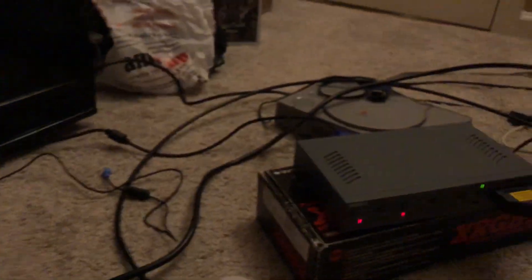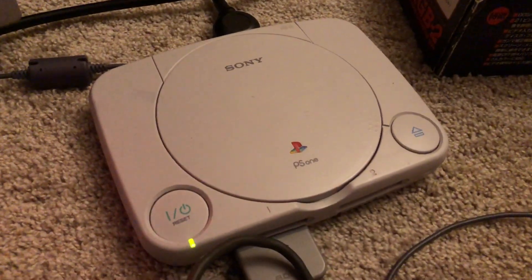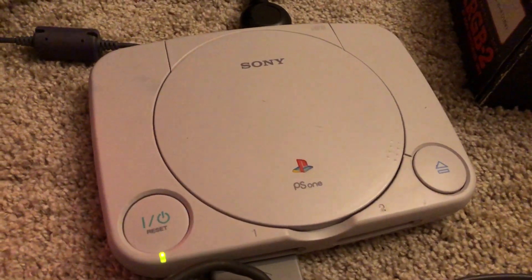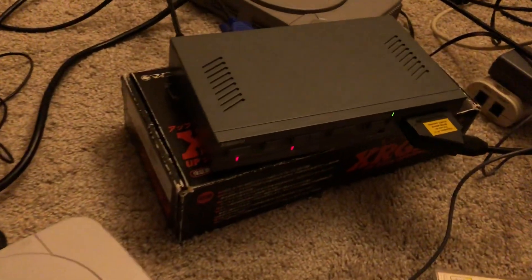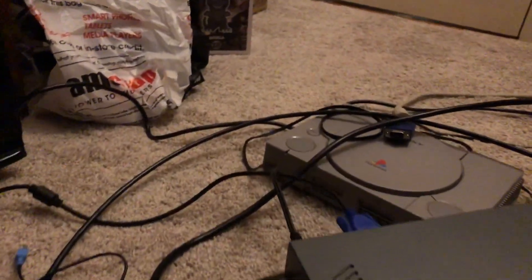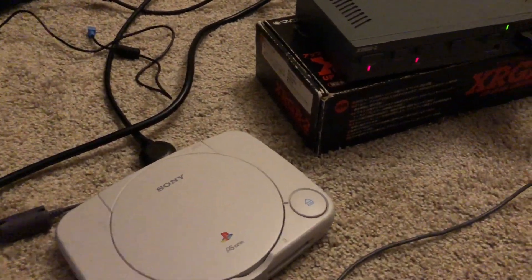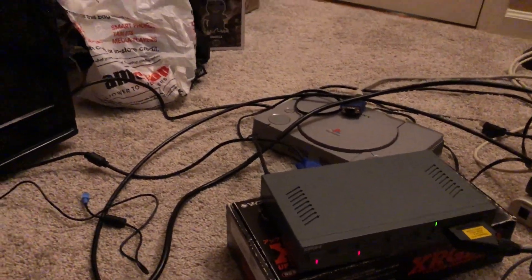How's it going folks? Today I have another monitor to show you, once again running in conjunction with an XRGB2. I have a modded, region-free PS1 console hooked up to the XRGB2 via JP21 pin RGB — that's what the inputs on these devices are. The output is VGA to this monitor, so basically we're taking the low-res 320×240p signal and using the upscan converter to line-double it up to 640×480p VGA. With this magical little box we're able to add these gorgeous-looking scanlines, which you would not natively get on a monitor such as this.